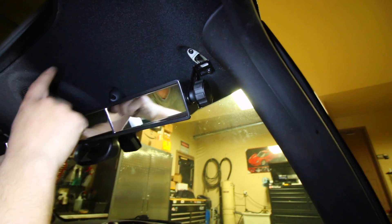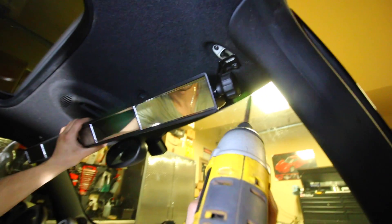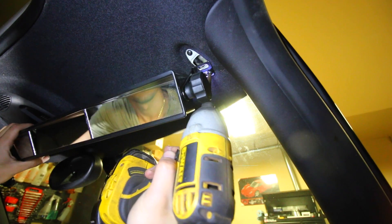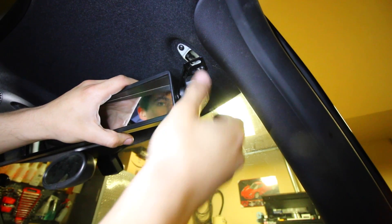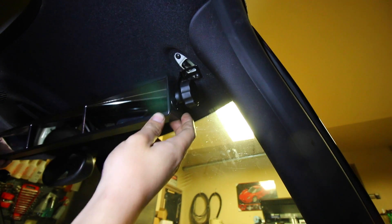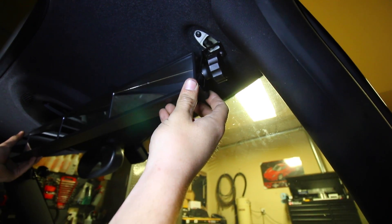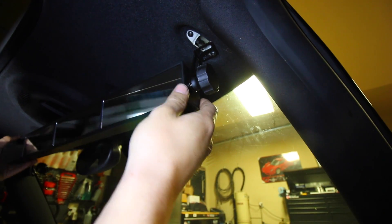Everything that you do here on the passenger side you have to replicate for the driver's side. Whenever you have it just mounted in place and it's in there, grab either an impact driver or a screwdriver and just drill this into place. Now I'm probably going to have to take the Wink mirror out by removing this knob and doing the exact same thing on the driver's side because I'm eventually going to want to move this up and down as I please. You don't really need a huge gap on the top — you want to have this basically as high as you can so you can see more stuff on the road, but as low as necessary so you can get the angle that you want.